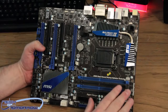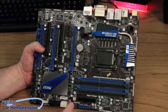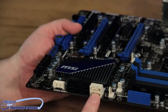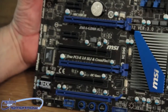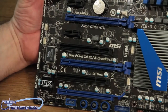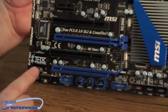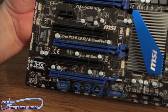The board supports 32 gigabytes of DDR3 memory — you can see the slots right here. The 8-gigabyte sticks are now out and available. Flipping it around, you can see all the different SATA connectors — you have both your Intel and your Marvell controllers on here, with the white ones being the true 6-gigabit ports. The Z68 GD80 has one, two, three PCI-E 16X slots, two standard PCI slots, and two PCI-E 1X slots. For sound, we have THX Dolby, which supports high enough quality for all your Blu-ray content at about 108 dB.